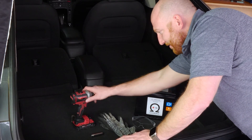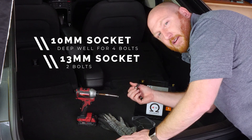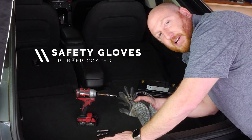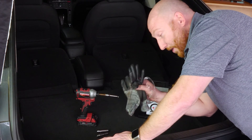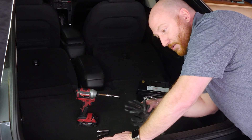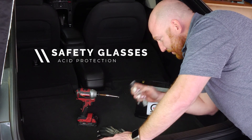Here are the tools that you'll need. I use a power tool to drive the nuts because it's quick, but you just need a 10-millimeter and a 13-millimeter socket. For the 10-millimeter, you will need a deep-well socket to remove those nuts. For safety — safety first — we use gloves with rubber coating, because you're dealing with a lead-acid battery and there's a potential for acid leaking out. You'll want something rubber or totally sealed to prevent the acid from getting on your skin. Also go ahead and throw the lead-acid battery into a plastic bag so the acid doesn't get on anything like the carpet or the paint. It's extremely corrosive and will eat through anything. We also use safety glasses for the same reason — you don't want acid potentially in your face.